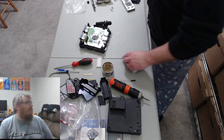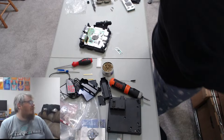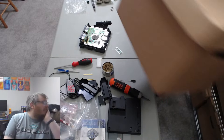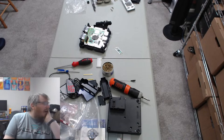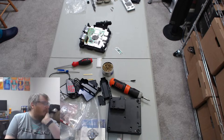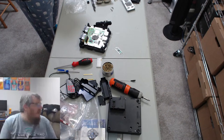Okay, so I'm going to need a couple of wires for this, right? Yeah, you need 5, I think. Do you suggest individual wires or ribbon cables? Because I remember you suggested something slightly different for the ground point when using your fan, right? Yeah, I suggested using the ground that's higher up next to the 3.3 volt instead of the one all the way at the bottom. In my use, I haven't run into any issues where it won't boot. But yeah, you need 1, 2, 3, 4, 5 wires.